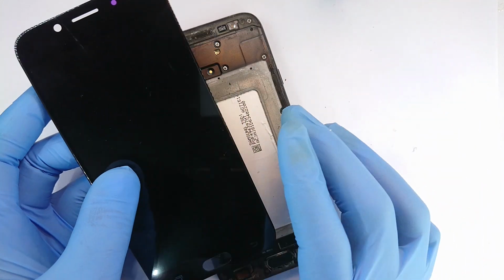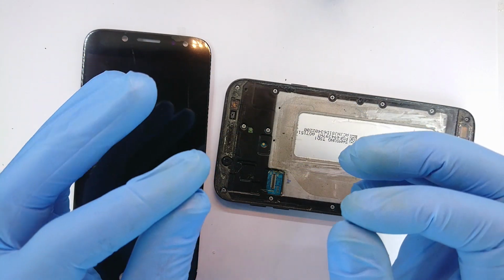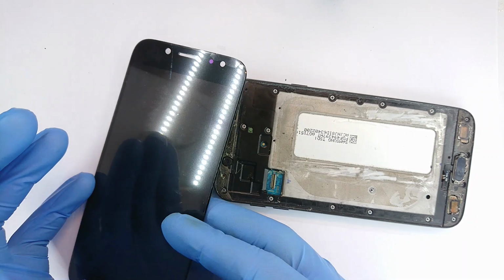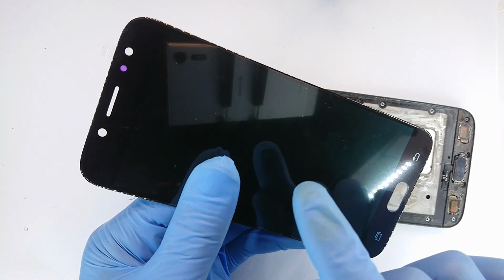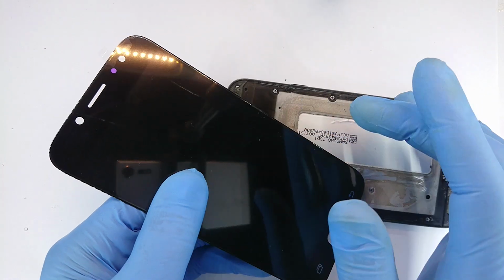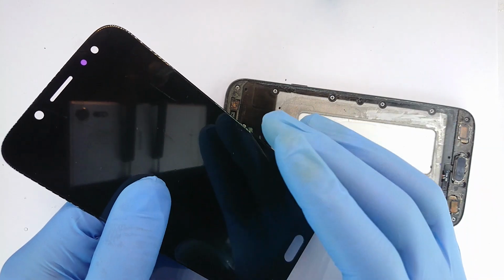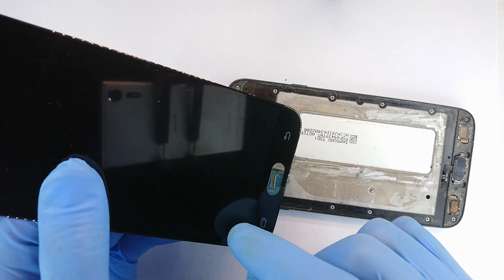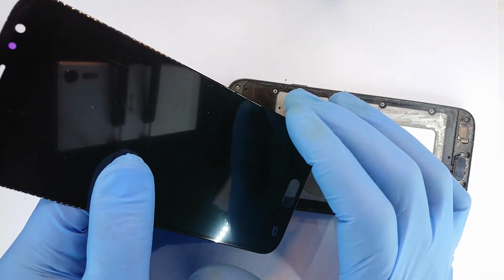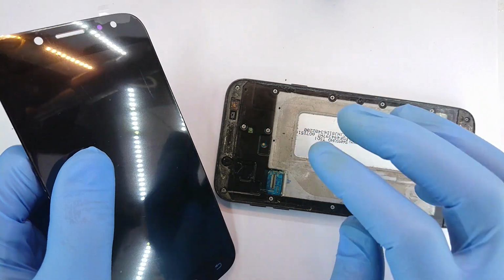Now, the second type, which is the OLED, is a bit interesting in that the qualities are actually very far apart. There's one whose resolution mimics the 400 pixels per inch resolution of the original screen, which I've gotten here. And then you'll find one whose resolution is just 720. It's not a full HD screen. And you can literally see the tiny dots or OLED that form the pixels, and it really degrades the picture and the quality of this phone.